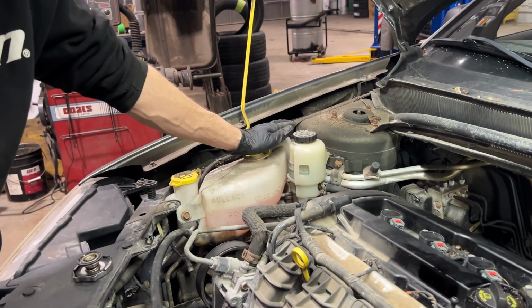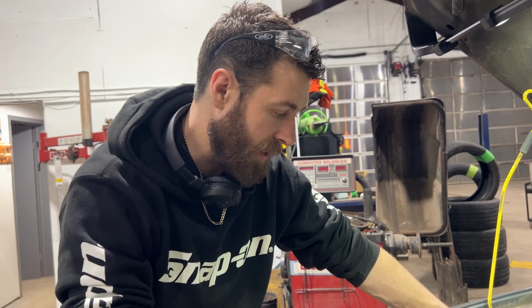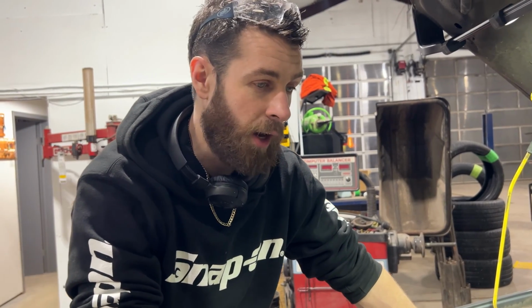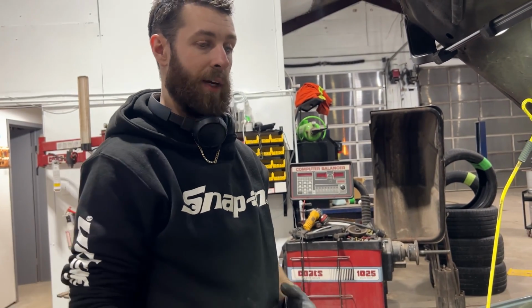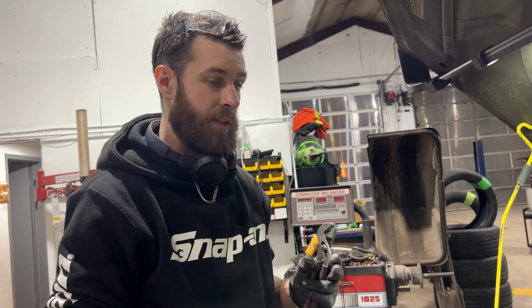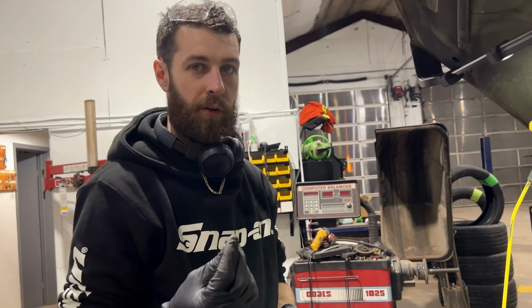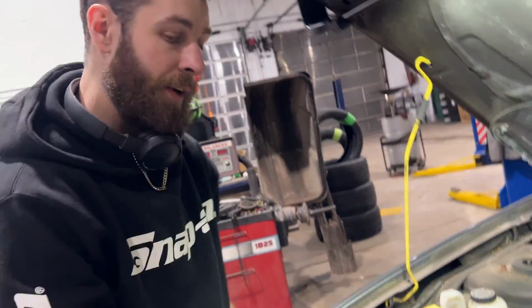This is Chrysler's 10-year coolant, or OAT, O-A-T. And like I say, it's good for 10 years. So this is a 2013 car. We're now in 2024. But what happens is, I find, even before the 10-year mark, the coolant starts to break down over the years, and it actually starts to eat away at the interior cooling system components, like your gaskets and mostly a lot of metals. And it's almost like you get like a silt or sand buildup. And I think it's all those small particles, microparticles, and a lot of it builds up and it collects inside of the heater core. And I think probably a bit of the radiator as well, but majority into the heater core.